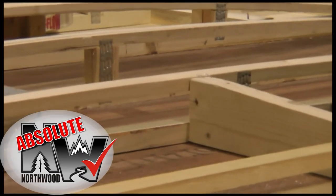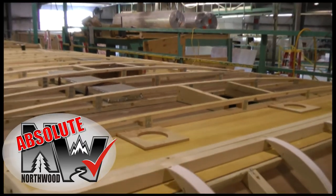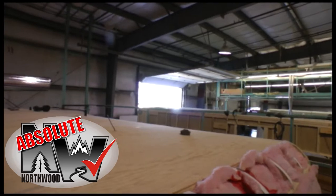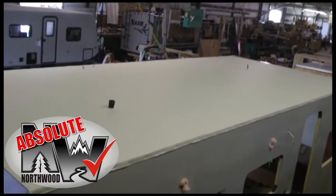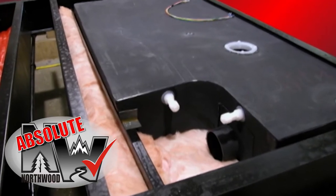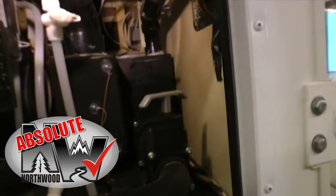Fully bonded Northwood roof truss system with up to 5.5-inch center crown for maximum runoff. Fully bonded inner ceiling and 3/8-inch bonded plywood roof sheet protected under a heavy-gauge one-piece roof membrane. All conditions fully insulated, suspended, heated and enclosed holding tanks with enclosed and insulated valve compartments.